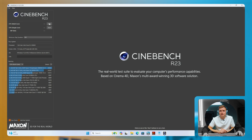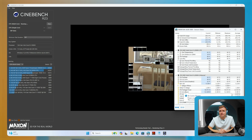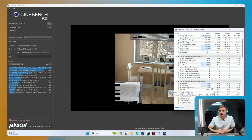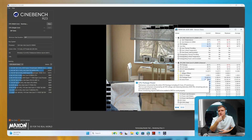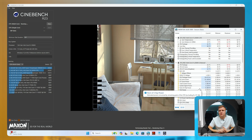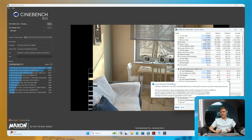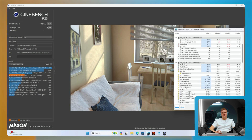Let's do a performance test on Cinebench R23 multi-core. We're pulling 50 watts, fans come on, and interestingly we're still not thermal throttling — pushing 55 watts through there. The PL2 has clicked in at 80 watts and PL1 at 35 watts, which is why it boosts differently. We're not thermal throttling, going up to 5 GHz, pushing 4.9 GHz. Performance is very solid — just under 11,000 points.